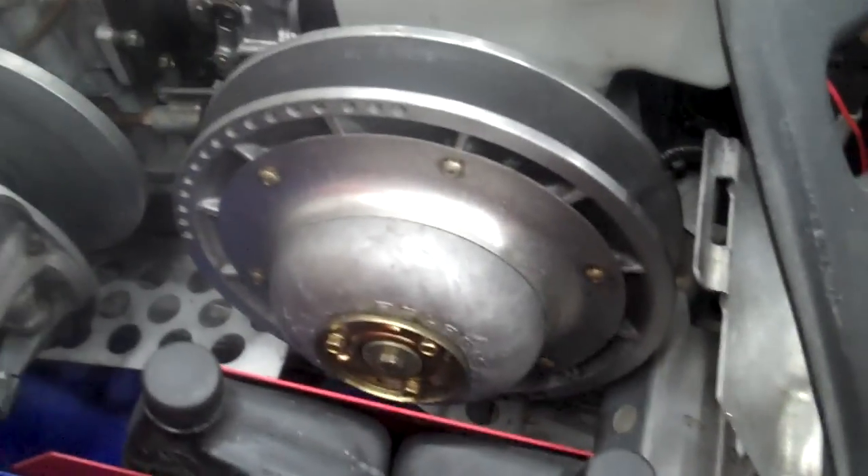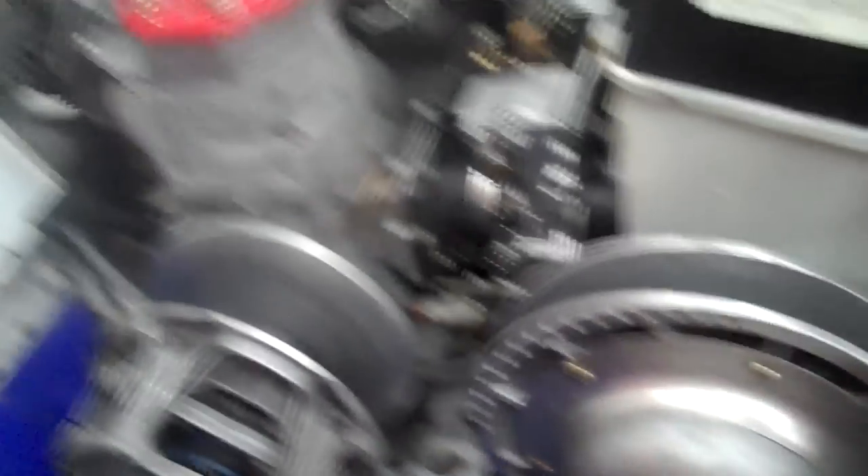One thing I should mention — there is a grease fitting there, and there's also a grease fitting way down there where your speedometer cable is. Follow your speedometer cable in, and there's a grease fitting right on top of that drive shaft. Those are pretty important. Remember, these things are spinning as fast as your motor is — 9,000 RPMs — so you want to make sure this stuff is greased. I've seen some severe damage from lack of grease there.